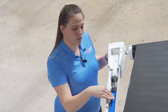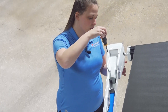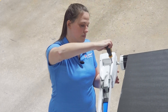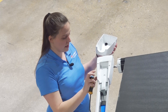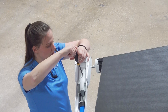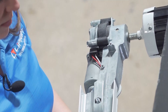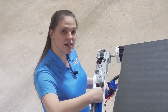Up towards the head assembly, you get a good view of where the battery is housed. Behind here, take your screwdriver and loosen those Phillips head screws inside this cover. The cover should come off easily after you've unsnapped it from place. You can also take this side of the cover off by removing these two screws. Here you can see the wires connected to the motor. When checking the harness coming to the motor, it should be connected at the bottom.